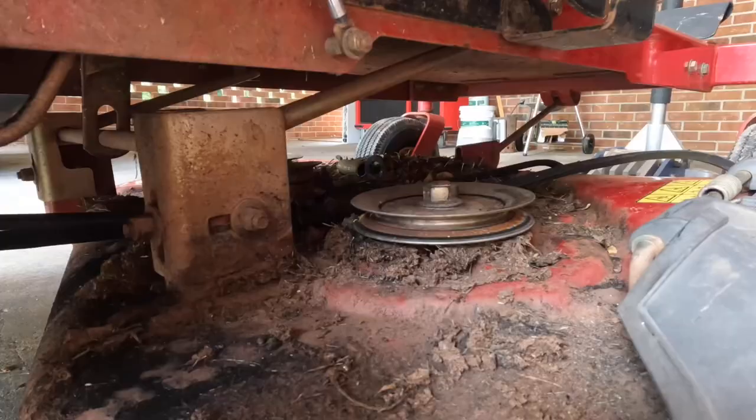Actually the pulleys are the same — this new pulley might be a hair smaller. Let me try to pre-thread this bolt and see if it works, and then we'll see if this doesn't bottom out in there. Let me get the belts out of the way.